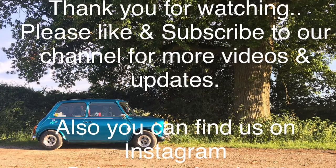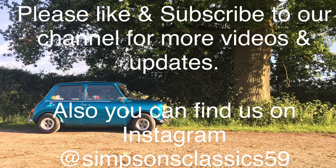That was just a quick video to demonstrate the rust remedy — the Hammerite gel — and to show you that surface rust doesn't necessarily mean let's cut the panel out. Obviously use your head: if the panel is very, very thin, very pitted and pinholed all the way over, cut it out. It's not worth it — it's your car, got to be safe. But that toe board there is well saveable. I'm going to do the repair from the other side like I've already mentioned, and I'm chuffed at that. Nice shiny bit on the car now. I want the toe board to be right, and this is why I've done that first — because the point is having a rotten toe board and trying to weld a new floor pan to it. But now we know the toe board's good, we can weld the floor pans to it. This episode has been a very cheap one — catch you soon guys, and we'll crack on with the next job.